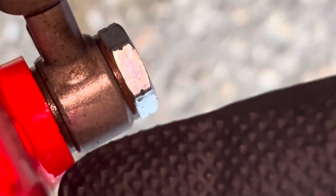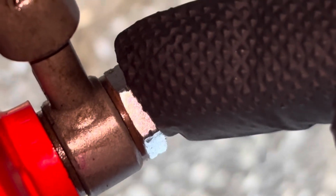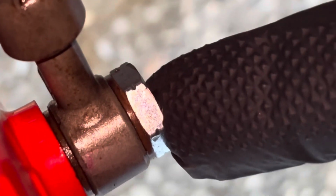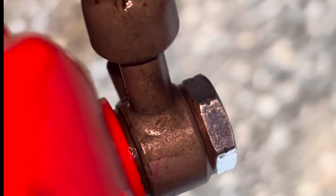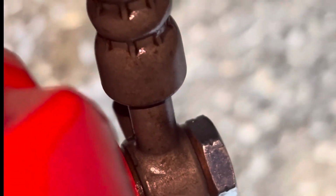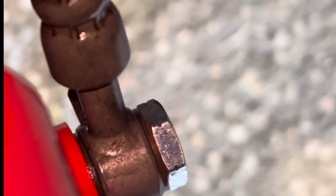All right, so basically it's going to be the copper washer first. Copper washer, the brake line, then another copper washer, and then the actual bolt. Now the new bolt is gonna be a 14 mil and the old one's gonna be a 12 millimeter. And just make sure if you have a non-Redsport model, the banjo bolts are not gonna fit the new big brake kits. You have to order a new banjo bolt. You can order from Z1 Motorsports. They're a lot shorter, but they're gonna fit properly.